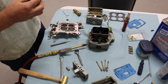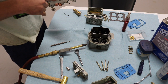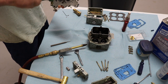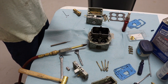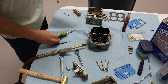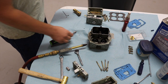Put a little Vaseline on the tap. You don't have to go in super deep, but it goes in super easy. Everything on the Holley carbs drills and taps extremely easy. You don't want to go all the way through because your set screw will go too far back. That should be far enough.